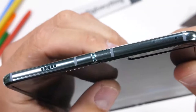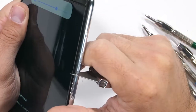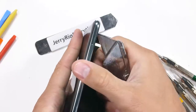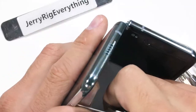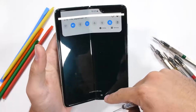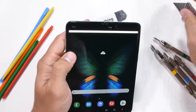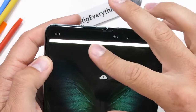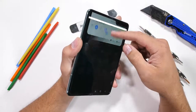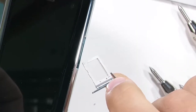We'll get a closer look at how the hinge works from the inside during the teardown. The frame of the Galaxy Fold is made from metal, along with both the power button and volume rocker. At the top of the phone, we find a microphone hole and a loudspeaker grill. Right about here is where we see the unfortunate gravity of soft displays — the tip of my razor catches the raised lip around the edge of the dynamic AMOLED display and pops the pixels like a marshmallow on a roasting stick, literally killing an entire line of pixels across the screen. One wrong move, one little accident, and now the whole top section of my phone is dead — pixels as well as touch sensitivity. This would never happen inside a normal phone. The Galaxy Fold does have a SIM card tray but no expandable memory. At least this tray has a rubber ring to keep some dust out — if only the rest of the phone had this same feature.